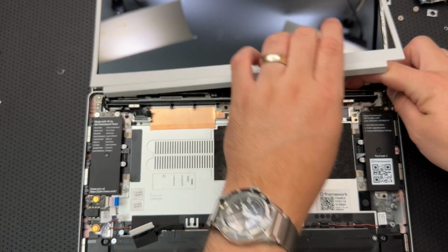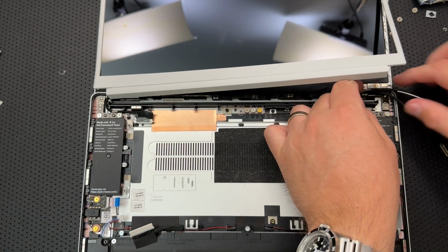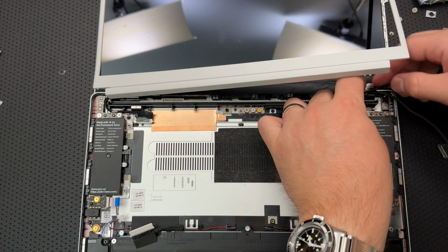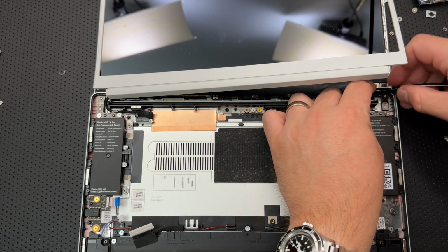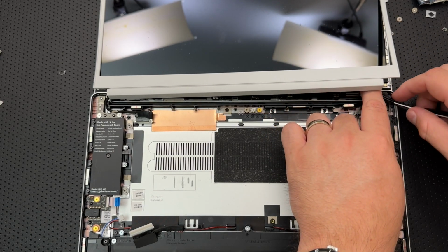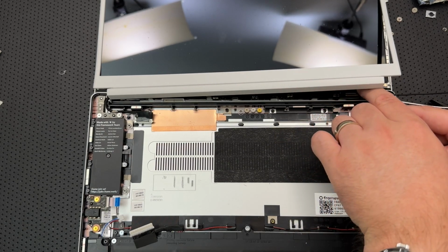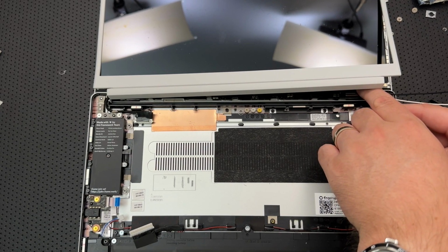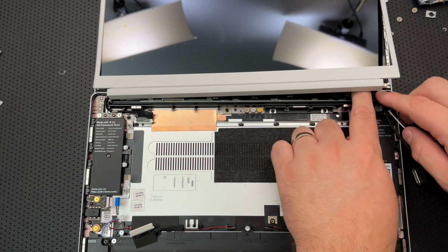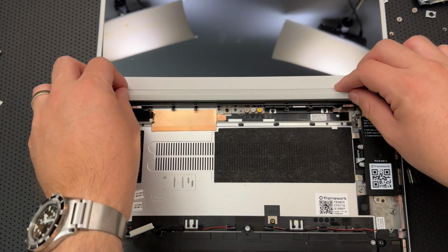Okay, so it looks like they need to go over the antenna, through the routing channels near the hinge. Through the routing channels over the right, through the rubber channels on the mainboard. This is a flat channel without a hook, so just make sure it's laying mostly flat inside it. Oh, okay. Can do that. Okay, yeah, there we go. That feels a little bit better.